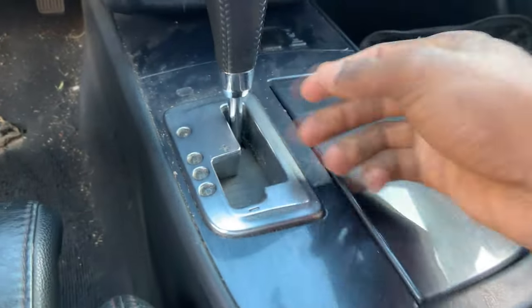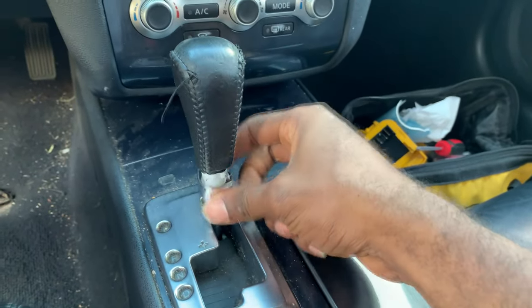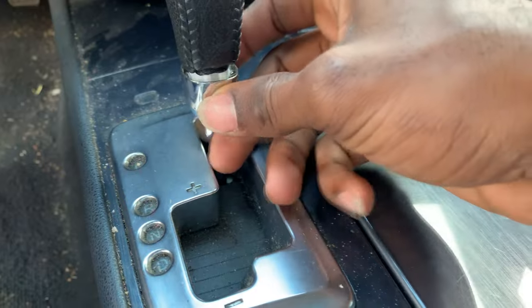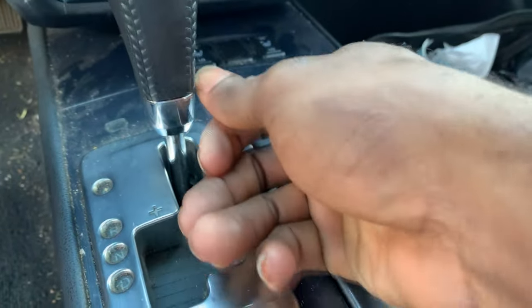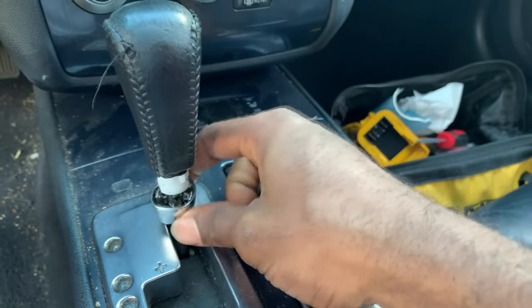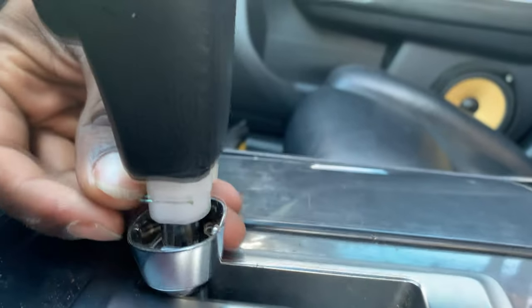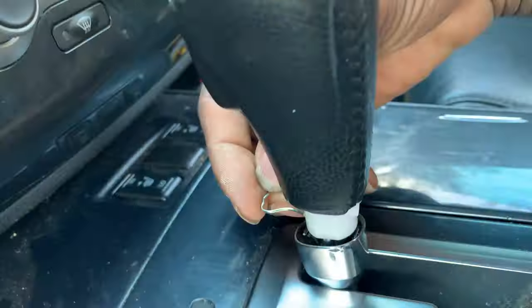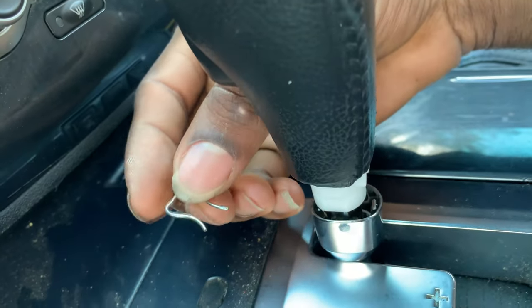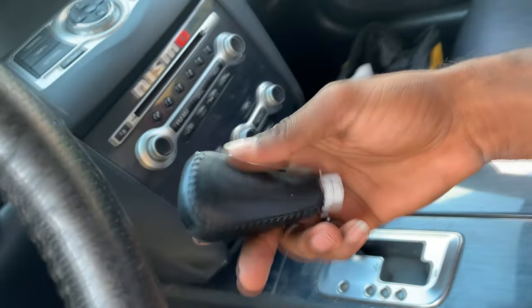You don't want to scratch your radio, especially if it's looking nice. To take that trim out, all you have to do is wedge a flathead in between right here. Wedge it right in between and it slides right down — you get access to this silver pin right here, which is the horseshoe pin. Just pry that out as well, and this bad boy comes right off like that.